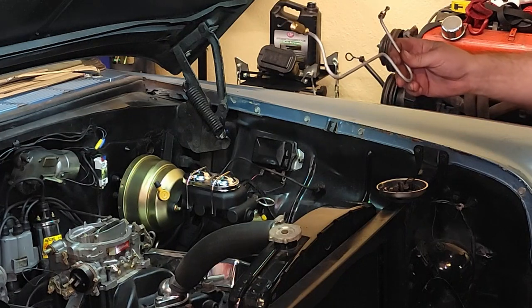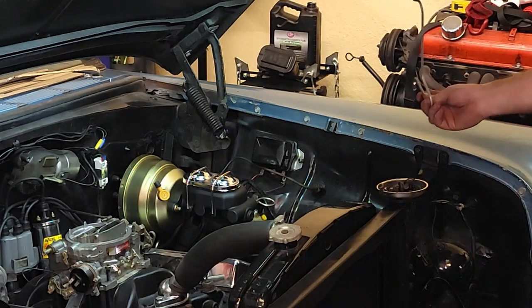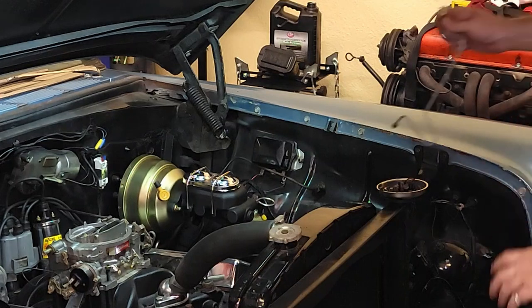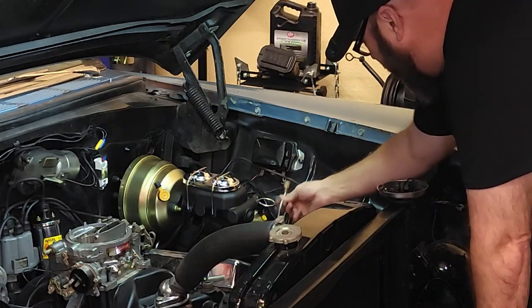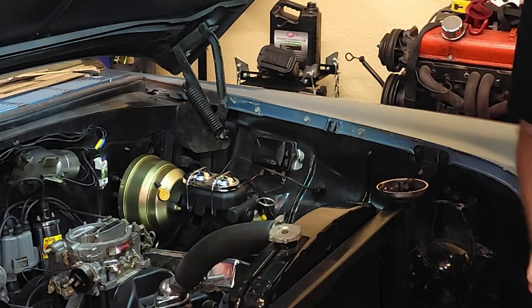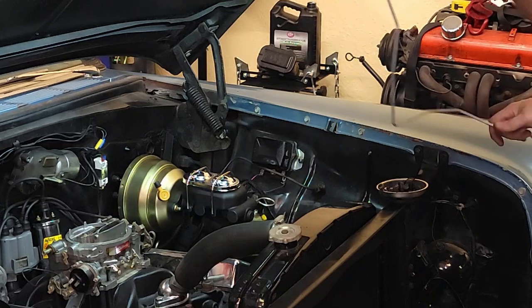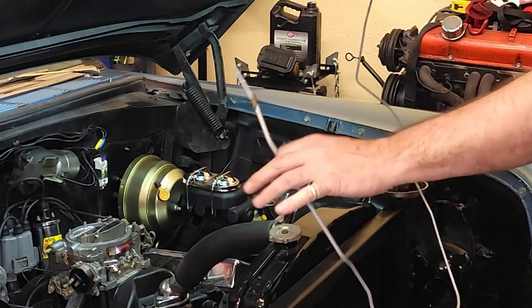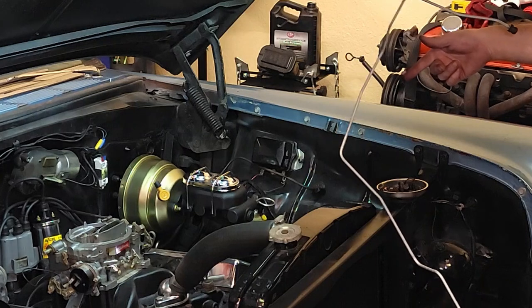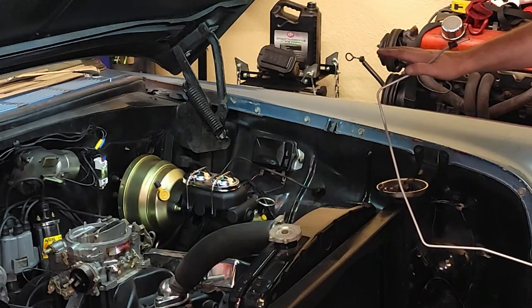They're acting like they know that this is for the driver's side, but it doesn't really line up with anything. So it could be a line that goes this way out the bottom of the proportioning valve to our front driver's side, and somebody just put that on the wrong side. I can kind of go along with that and make it work. That's fine. Here's the big nut for the rears. Would come off the back just like that. And what, go all the way to the passenger side? I might be getting ahead of myself. I could have sworn I saw a distribution block on the frame for the driver's side brake line for the rear.